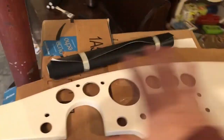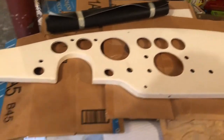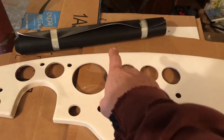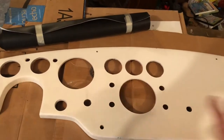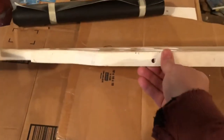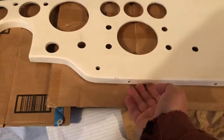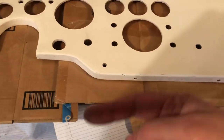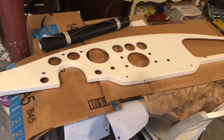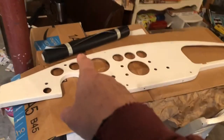The theory is: I'm going to cut the piece roughly in shape — it has to fold all the way over. Then I paint the contact adhesive on the vinyl and on the dash, let it dry for 15 to 20 minutes, then stick them together. I want it to fold over well, because I've seen so many Factory Fives where the vinyl is peeling up from the bottom edge. The Factory Five dash is aluminum; this is fiberglass, so it should adhere a little better.